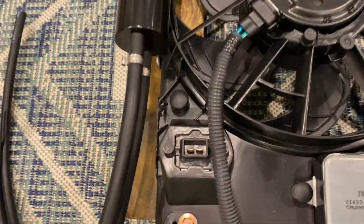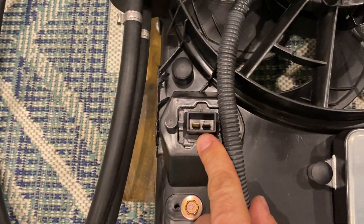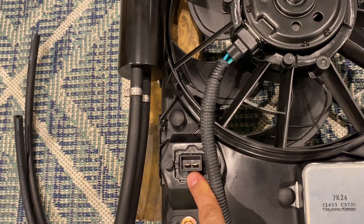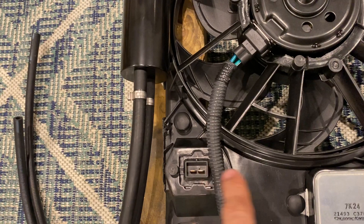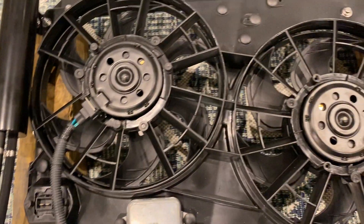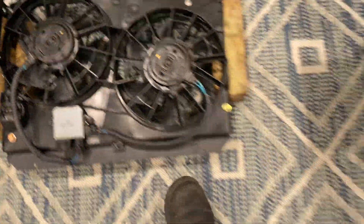You do need to use the resistor that is on the contour fan. So one of your wires outputting from that Volvo relay will go into this - one wire comes out into one side and then splits out to each fan. That's how you get the low speed. The high speed would be directly connected.